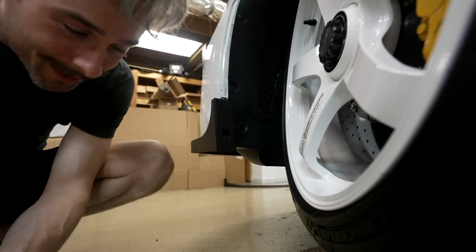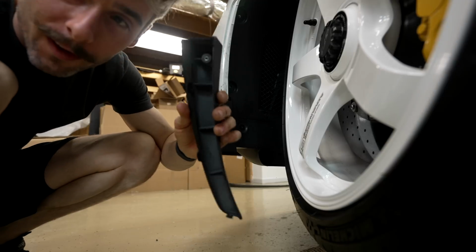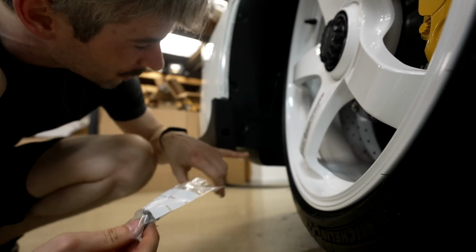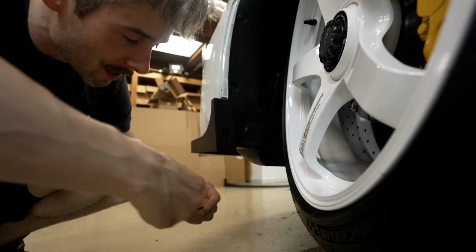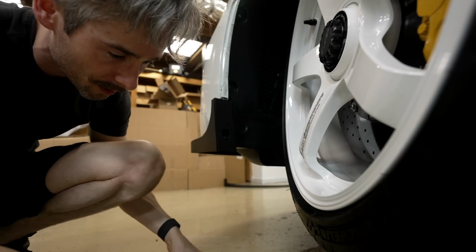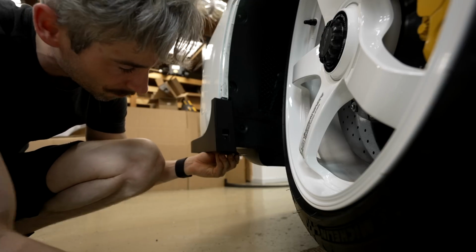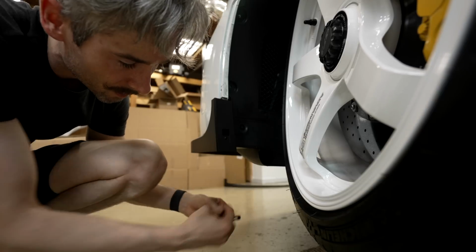Alright, I'm going to try to show you how to do this. So you got the side piece, right? You got the little screw. This is the hardware that they provided. You got like a nutsert, and you have another OEM little hex bolt, and you got this flimsy L bracket here. This attaches to the stock mounting location here, and since this lip is wider, you use the nutsert. Then one of these bolts goes in that hole, and there's just a random hole there for some reason, and then the other one goes into the stock nutsert.